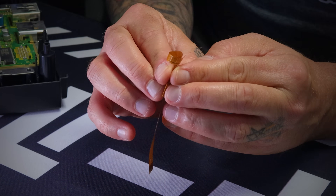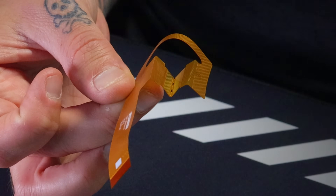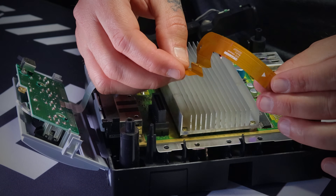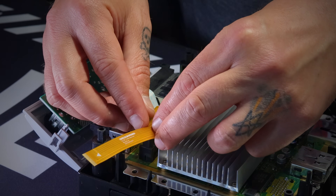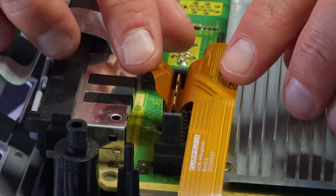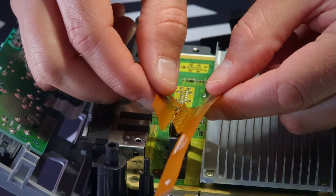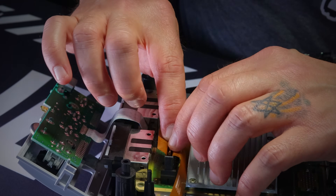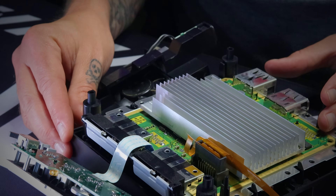Once you're there, give it a nice little squeeze — not too hard — folding it into this W or M shape. So now with our Flippy Drive origami ready to go, we're going to install it. Start by making sure the arrow is pointing outwards against the heatsink. Fold the whole thing into halves and slide it right into the slot — it goes perfectly in there right against those pins. We're going to take our little W shape, arrow pointing outwards, fold the whole thing together in the middle so it sticks into the slot, push it all the way down, and make sure it makes a nice firm connection with all of those pins. Fold the edges down to the sides a little bit against the heatsink so they're out of the way. We have installed the flex ribbon cable!